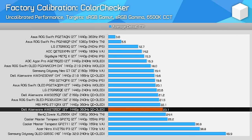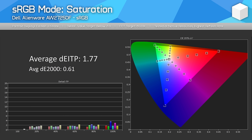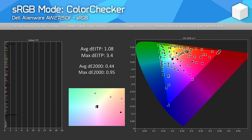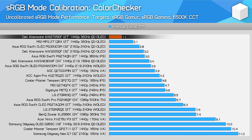Calibration can be significantly improved through Alienware's outstanding sRGB mode. While Dell do lock some settings in this mode — you can't change white balance, for example — my unit had exceptional accuracy from the factory, which makes this a non-issue. The results seen in this sRGB mode are the most accurate I've ever tested from a gaming monitor. This mode is on par with a full software calibration and cannot be improved further — overall Delta E performance is in the 1.0 range, which is elite. While the MSI equivalent also ships with an excellent sRGB mode, the Dell model is a step better in both grayscale and colour checker — the best results I've seen testing over 150 monitors.